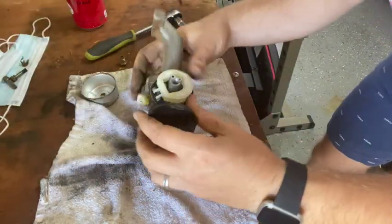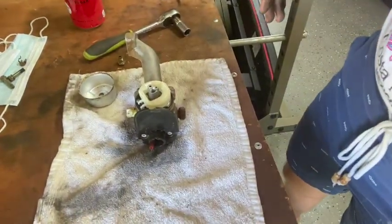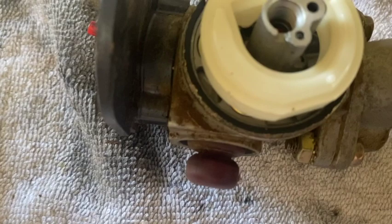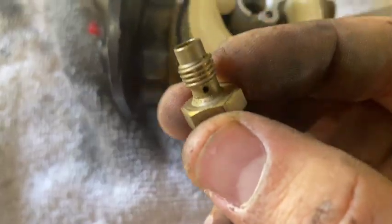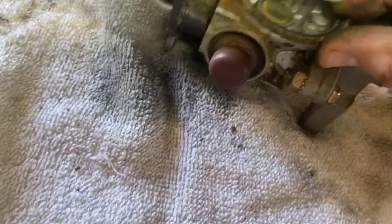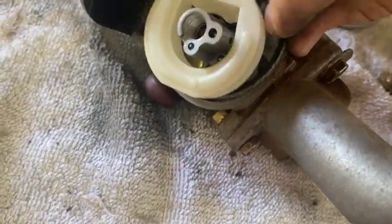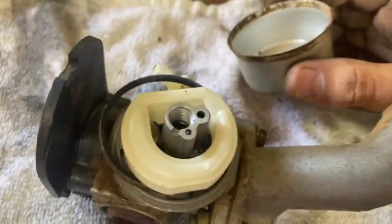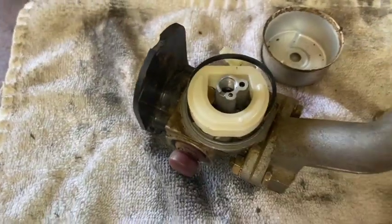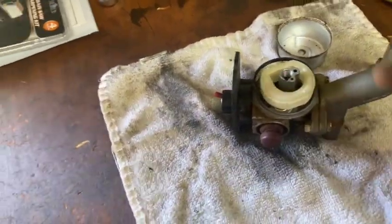Let me get a good angle — this thing is beautifully clean. So this was a surprise. Look how clean that is. This is the jet right here, this is the main jet. That looks super clean, I don't see anything in it. That looks really clean. This gasket looks like it's kind of a bit of a problem — I'll fix that. But other than that, I'll clean up the bowl here because it looks like it was probably leaking a little bit. This carb, I think, is in perfect condition.